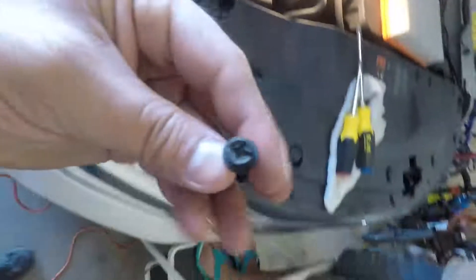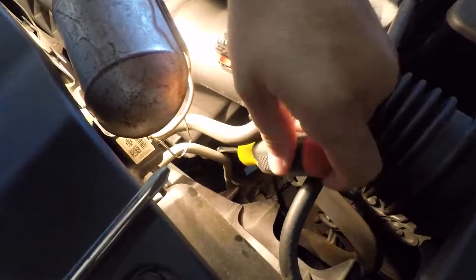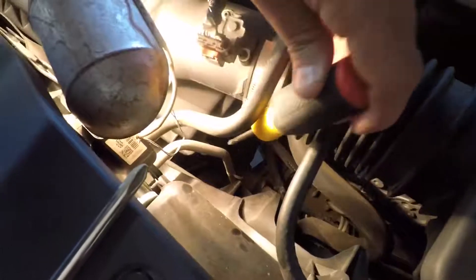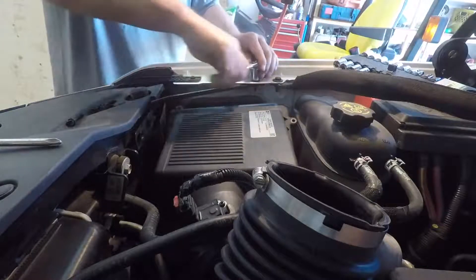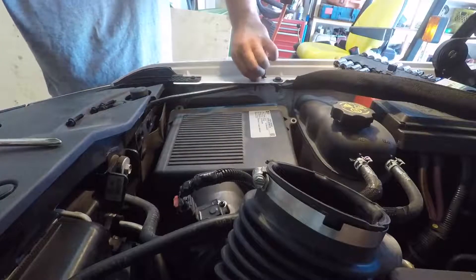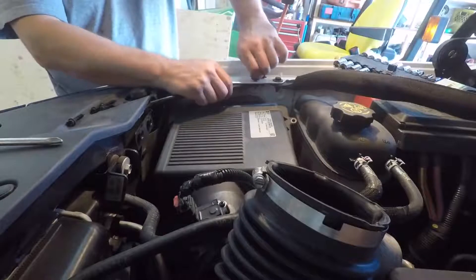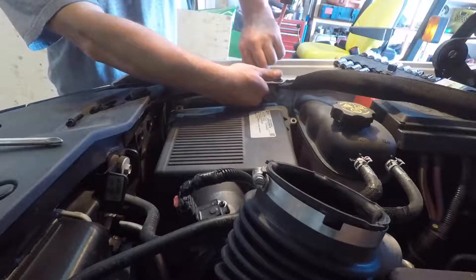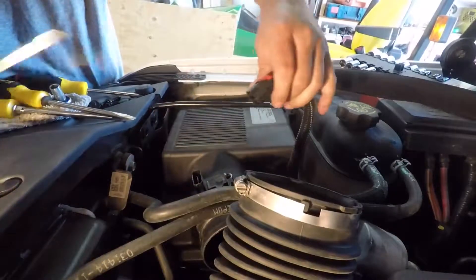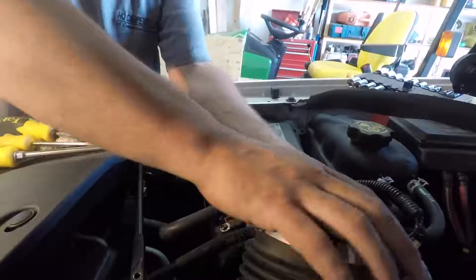Here's the air filter area. They put this fastener — or this air conditioning line — right in front of where you've got to take the bolt out. Brilliant, GM, just brilliant. It's been about eleven minutes doing this. Take this bolt out, take this wiring harness clip off here, and we're going to swing this bracket over so you can get to the holy grail of air filters.